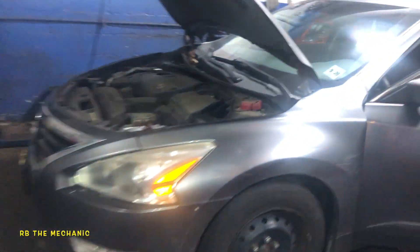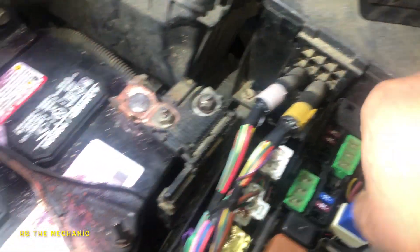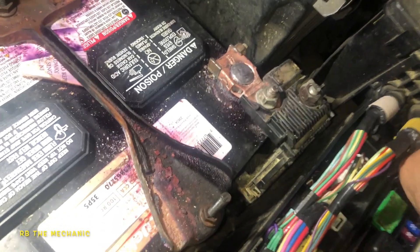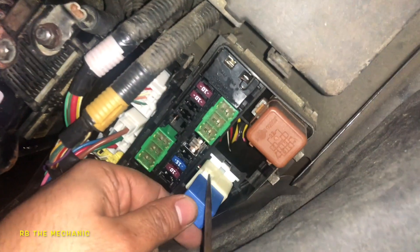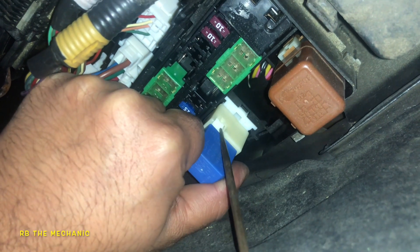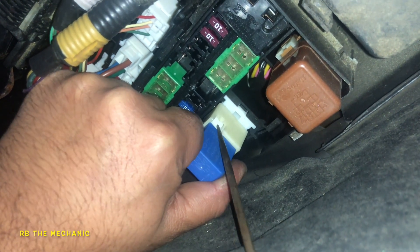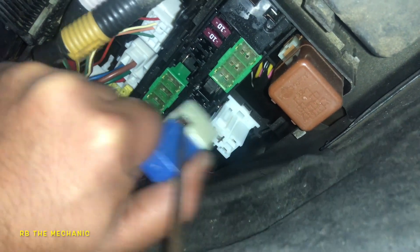This is my pick. So what I'm gonna do is have my friend hold this and I'm gonna try to pull this relay out of there. So we're gonna take out this relay — push in on this tab and this relay will come out. There you go. This is what this silly relay looks like. This is the problem.